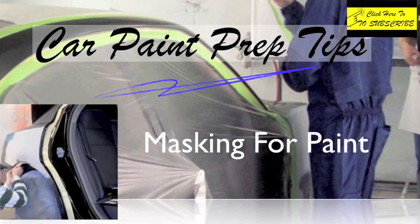Now, before you start masking the jambs, make sure that you wipe all the jambs really good with wax and grease remover, or the tape's not going to stick well. So clean the jambs really good, and then one method is just like you see in this picture where we're using 1.5-inch tape.